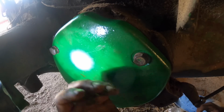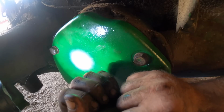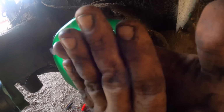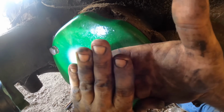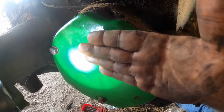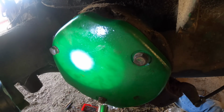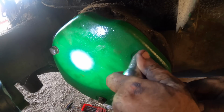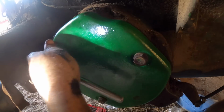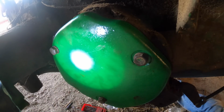This works, which I should have explained earlier, and I think I did in that one video. When you pull on that rod, it just moves those two plates apart. There's steel balls in between and they ride up out of each other, and that just expands this whole operation. So yeah, let's see here, double checking, got distracted.